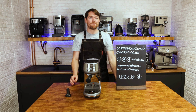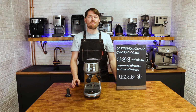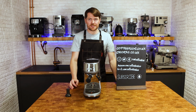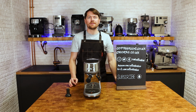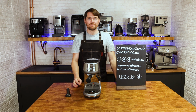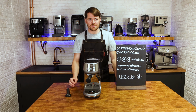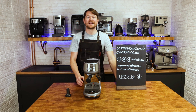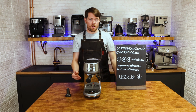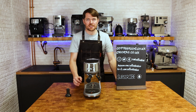When I say the two main problems of cheaper domestic espresso machines, by the way, these are pressure and temperature stability. Nearly all the cheaper espresso machines on the market, up to and including the DeLonghi Dedica, and click here for my video on that machine, have pumps that deliver 15 bars of pressure, and they don't have an OPV or overpressure valve. The Bambino, as with the Bambino Plus, has a 15 bar pump, but it has an OPV, an overpressure valve, set to 9 bars, the widely accepted ideal espresso pressure.